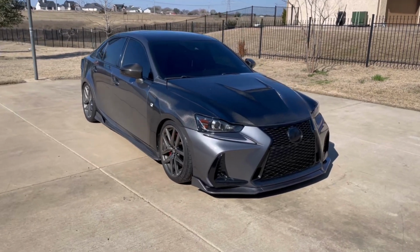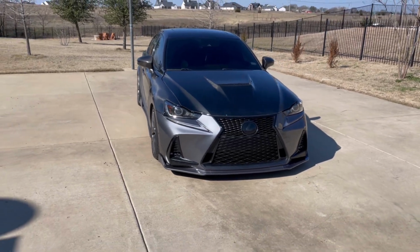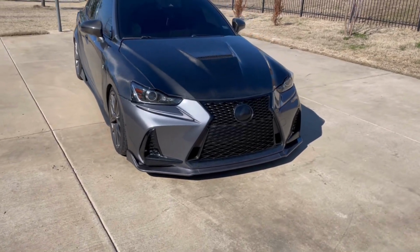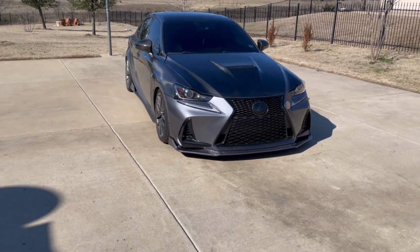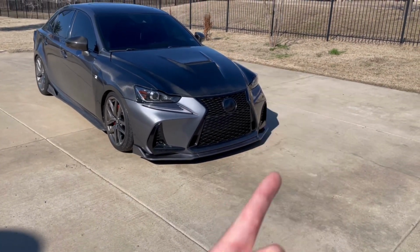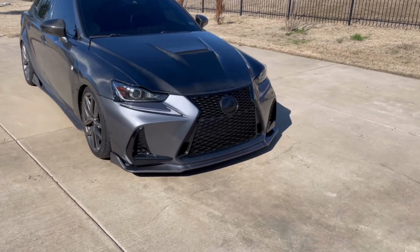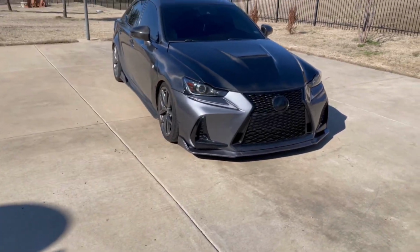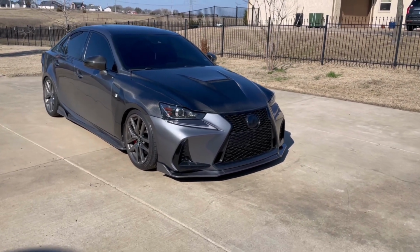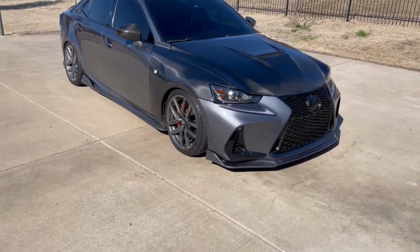Well, as you guys can tell, just like painting the front lip, installing a front lip is not as crazy or intimidating as it might seem. I've been told by a couple people that their lips have flown off on the highway or the freeway. So this should prevent that from happening. The even distribution of all of those screws across the front lip should hold this front lip on perfectly. By the way, those self-tapping screws are 1 inch. So that's about all you should need to protrude into the front bumper enough. But this method seems to be foolproof from when I've used it, and so I highly recommend it.